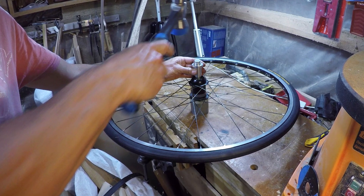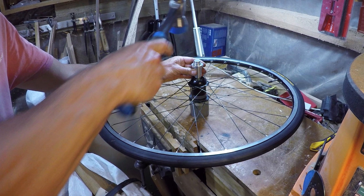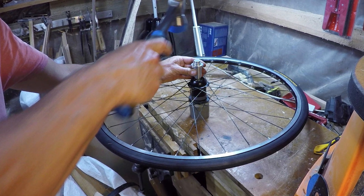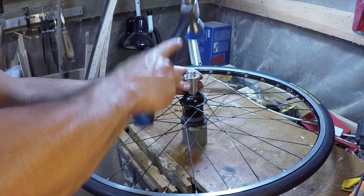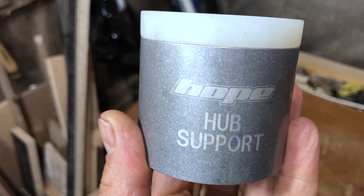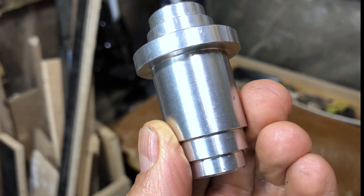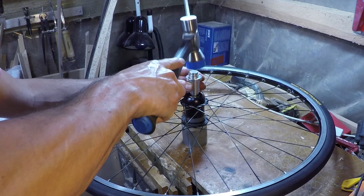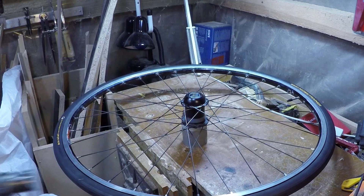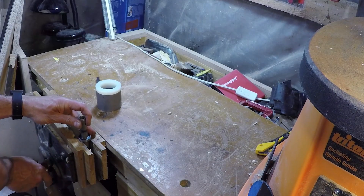For the hub bearings I'm using the axle itself and a nylon faced hammer to remove both bearings. It's important to remove the drive side bearing first since there's a magnet on the axle which will prevent it from coming out the other side. Place the wheel drive side down over some support — a couple of blocks of wood, for instance. I'm using Hope's hub support bush which comes in handy. You'll need something to fit over the axle to punch it out that won't damage the axle — I'm using an aluminium drift. A couple of short sharp knocks of the hammer will knock the axle out with the drive side bearing attached. Remove this bearing from the axle by resting it in between the soft jaws of the vice and tap in the end of the axle.